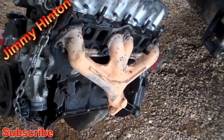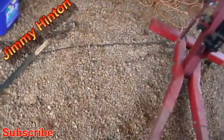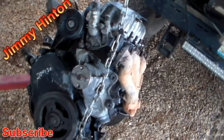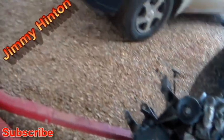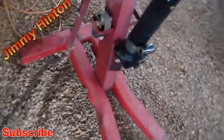This is the second day after I pulled the engine out, and the engine compartment is empty again. Two hours after pulling the engine out — it don't take long to get the engine out. It just takes longer to get it back in because you're having to line it up. There are pins back here on this motor that you have to line up, and there's one in the transmission. You also have to line up this clutch right here on the transmission — the input shaft.